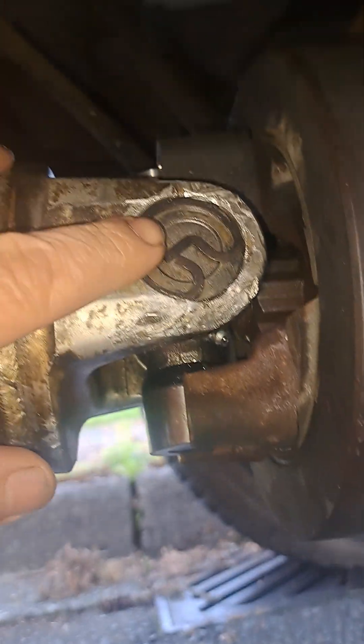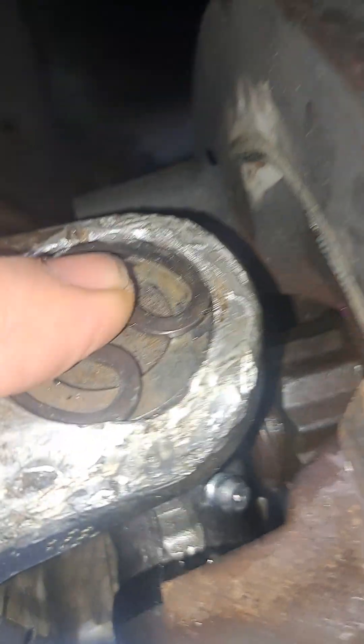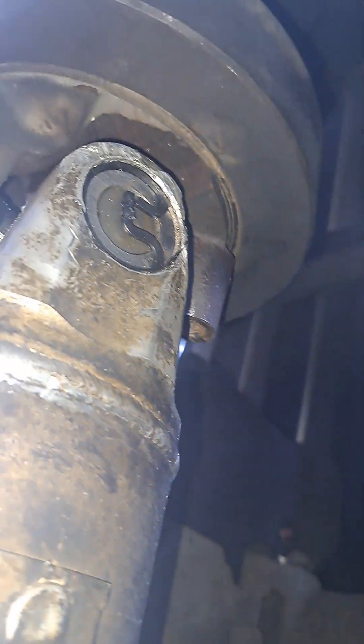Now the other concern: this is the u-joint. When this fell, it scratched it up and these have retainer rings that have to sit inside a groove. The groove is there and the ring is inside the groove, but the metal around it has been compromised on this side. The ring is sticking out — it's not sitting flat because the groove has been compromised from when it fell out, so I can't get this ring to fit completely flat in there.